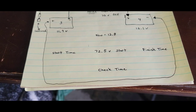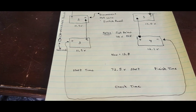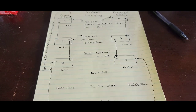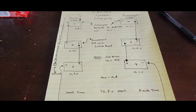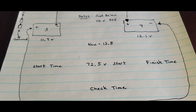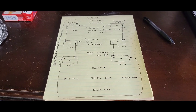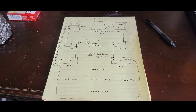I have a finish time and a check time column. Knowing this, I'll probably charge for about an hour, write the time down, come back, and put my check time. When it's fully charged I'll log my stop time — probably about two hours total. I'll check it every hour because unfortunately this battery charger doesn't have an automatic shutoff. I'll check all batteries individually and write them down, then check the whole system together. I'm putting this together as an educational video to help out guys with the charging system.